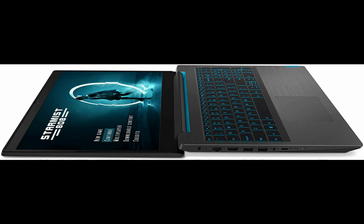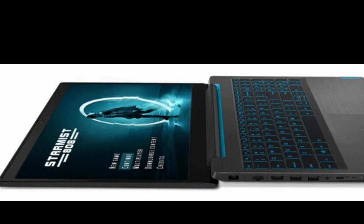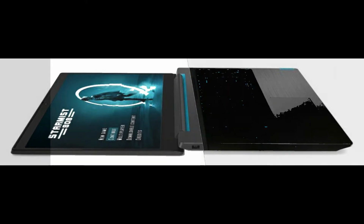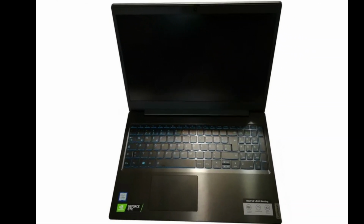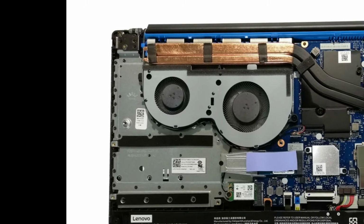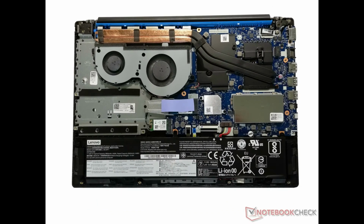Compared to the other laptops in our test field, the individual results in the multi- and single-core disciplines also confirm a very good utilization of the performance of the Core i5-9300H. Only the AMD Ryzen 7 3750H of the ASUS ROG Zephyrus G has better results in multi-core performance. On battery power, the multi-core value of the L340 is also about 53% lower than when plugged in.